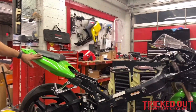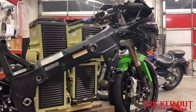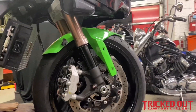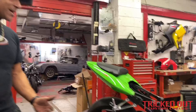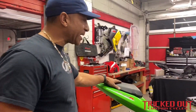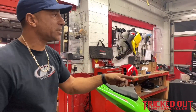The sides are black. We're going to do a quick shoot on the tail section and tank. We're mocking up the front fender and making some fender mounts — we found a Kawasaki Z1000 front fender we like the shape of that was sitting in the back, so we're running with it. It's really coming along good, made a lot of progress today. There's not too much more rough fabrication to do. We're going to make a wiring harness for the lighting system.